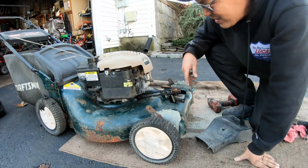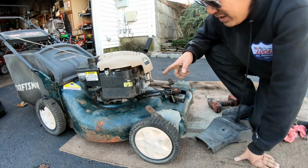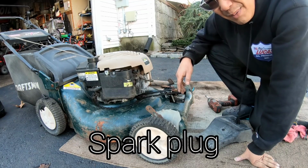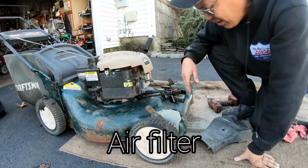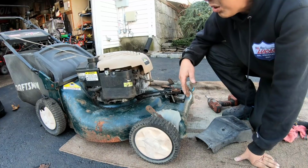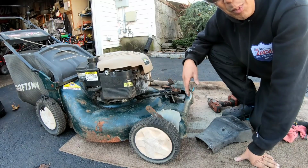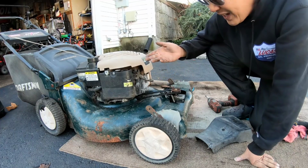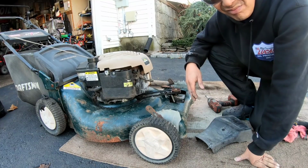I checked the blades and all that stuff, but we did a lot to this, man. Changed the battery, it started the motor, cleaned the carburetor, tightened the throttle plate onto the engine block so that the intake manifold mates well and seals well with the carburetor. And then it started and ran okay. There's no smoke coming out, surprisingly, but this Key Start Big Baggers front self-propelled Craftsman 6.5 Quantum lawnmower works. I just used up all the gas that was in here. It's good for storing for the winter. Anybody want it? Let me know.